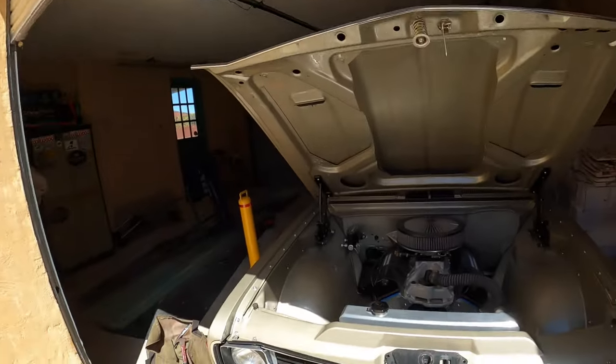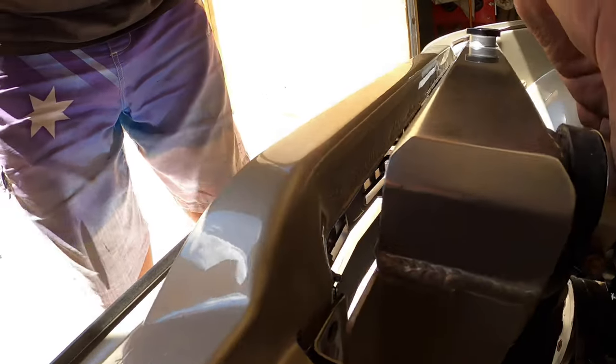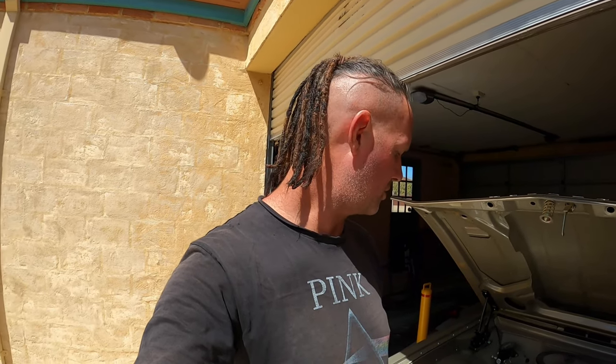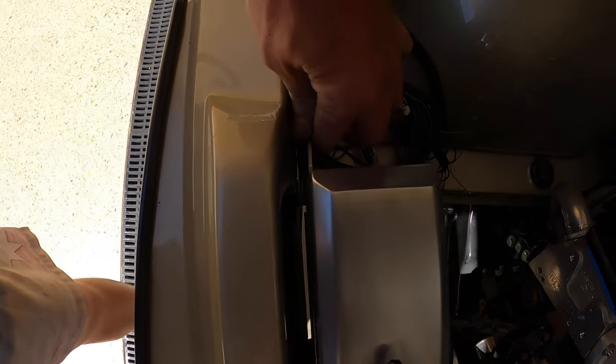Back at the car — the radiator is just sitting there. I haven't drilled the mounting holes yet because I believe you've got to rubber-mount the radiator so the aluminium isn't touching the metal, and it'll stop electrolysis and corrosion of your system. I'll leave that for now and go to an exhaust shop — you can get little rubber isolators with a male bolt end on either end with a bit of rubber in the middle to cushion the radiator.